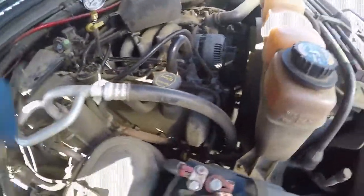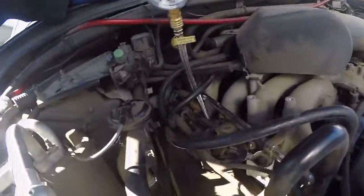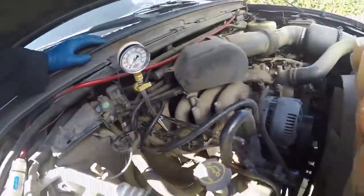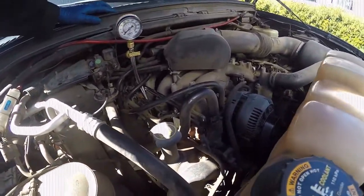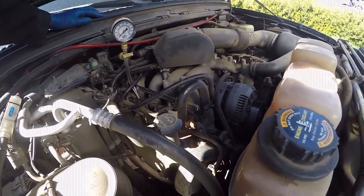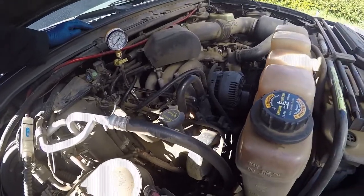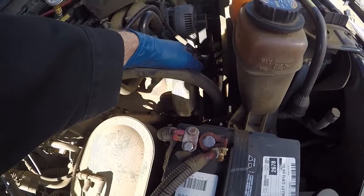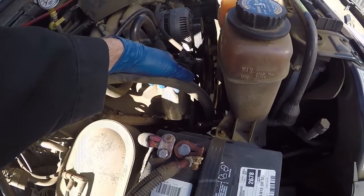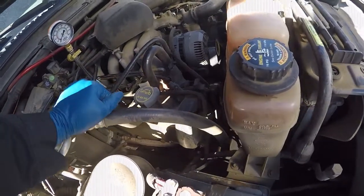because I'll show you this on the GoPro. There's a lot of stuff back there. And I mean, that thing goes all the way back there. And the shop I used to work at, we've been talking back and forth about what it is we're gonna do to get this cylinder head off. And there's other things that I wanna get done while we're doing it, which is replace the timing chains and tensioners and the guides on that. Which, I mean, you gotta pull those off to change this cylinder head out anyway.